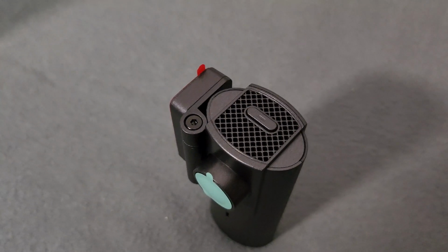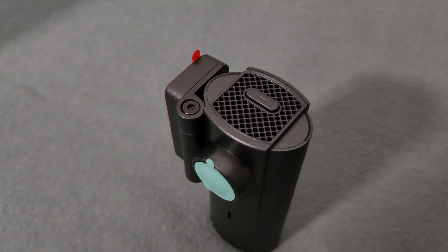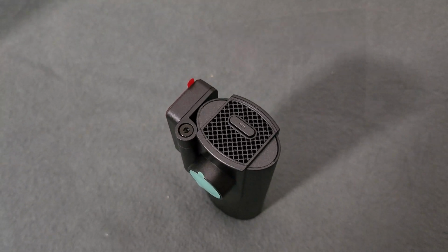Other than that, the other thing I wanted to confirm was the button on the side of the camera. So that button does function as a capture button, and I'm just going to refer to the manual real quick for its functions because there's multiple. So it says press for 1 second to lock a video. So if you have something happen in front of you and you're like, oh, I want to save that, and you just hit the button, it locks that video to a specific part of the SD card that won't automatically be overwritten. So you can pull up your app sometime later. It'll probably have a section that says locked video or whatnot, and then you could probably choose that video, download it, and then you can delete it off the camera when you feel like it. But it won't be re-recorded over automatically.